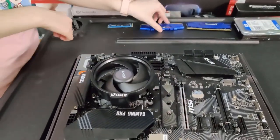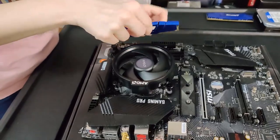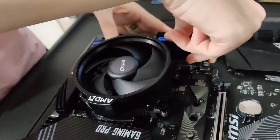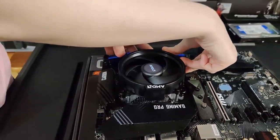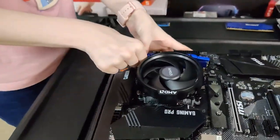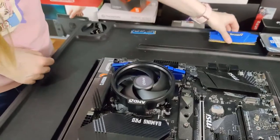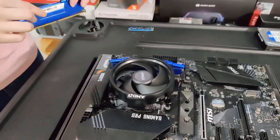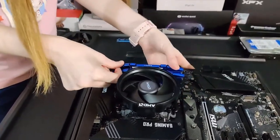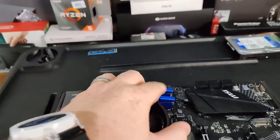Next is the RAM. You've been paying attention to what I do a lot, haven't you? So let's get a few of these in. Are you going to get the right RAM slots? That would be the first one and the third one — that is correct. Do you know why? It's because those different slots correspond to different channels. If you have two memory sticks in slots one and three, you get dual channel memory, whereas they run in single channel if you didn't have them like that. Some boards, this one included, won't even boot if they're in the wrong slot. Looks like you're down all the way — looking pretty good.